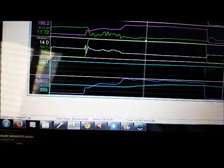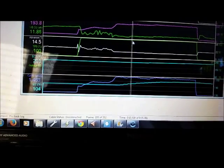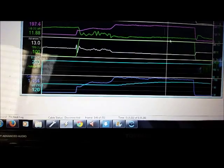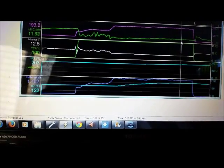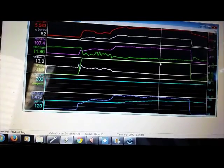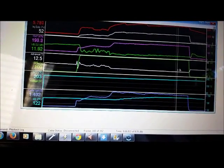So the intake air temperatures from going right back in the lanes over and over are starting to get high, up to 122 degrees, which ain't hateful, but I have the tune set up for methanol injection, even though I don't have methanol injection on it yet.